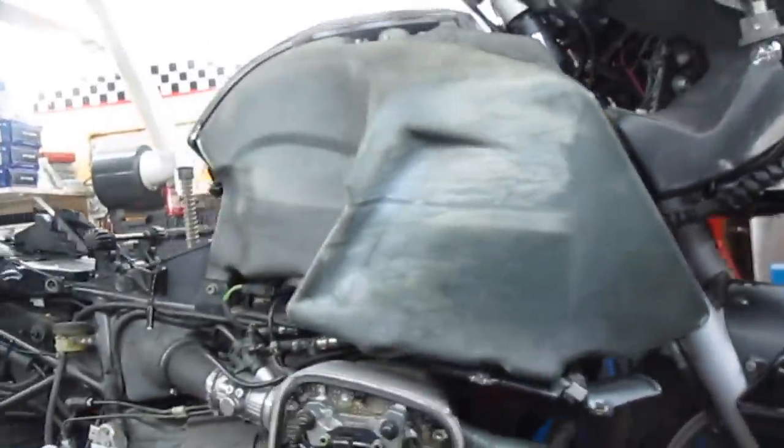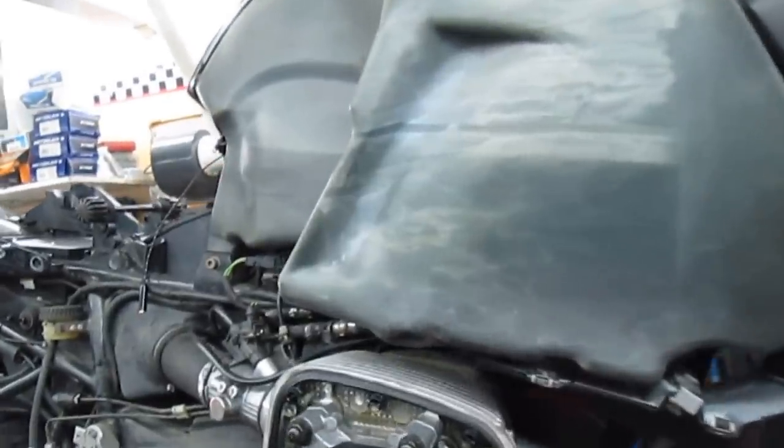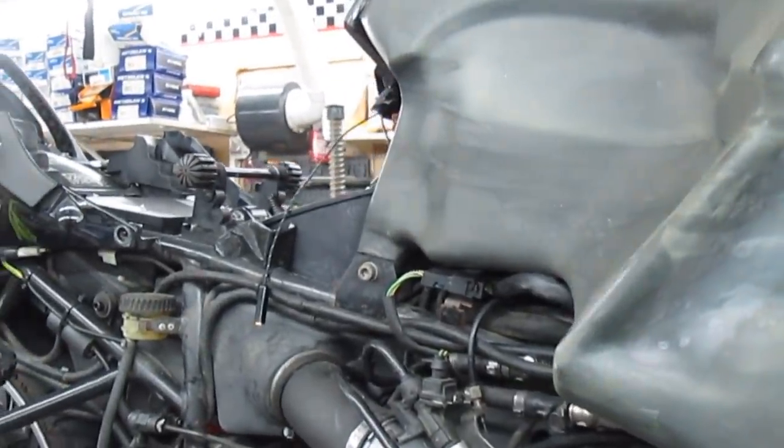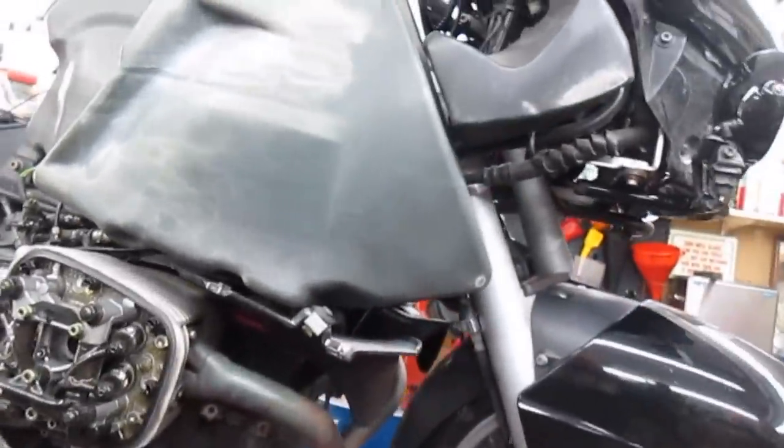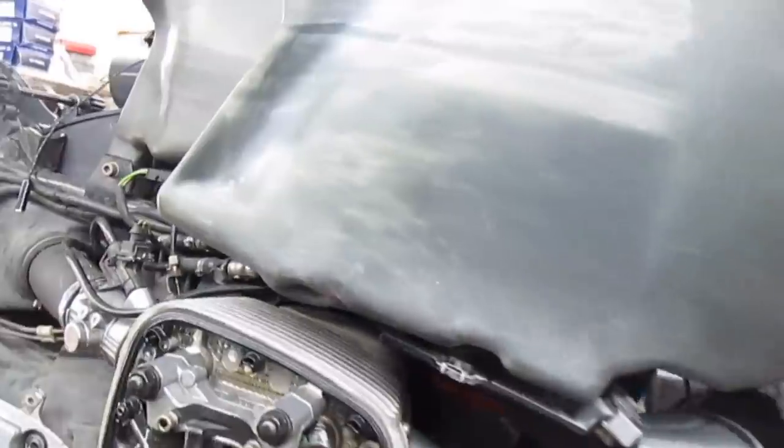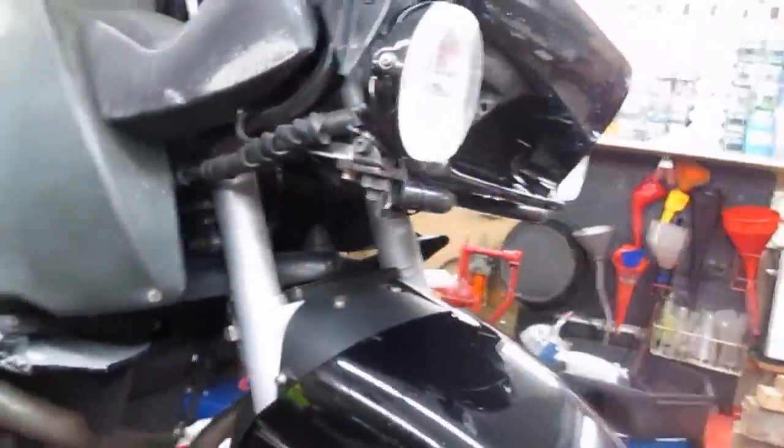If it rises and there's no place for it to go, it ends up causing the clutch to slip. You won't even notice until the friction material is worn into the rivets, and then it will really slip. So we'll be investigating that clutch circuit momentarily. Get that fluid changed.